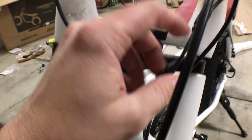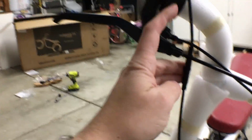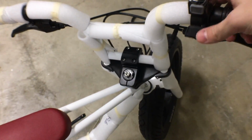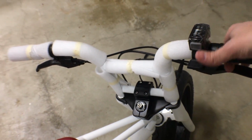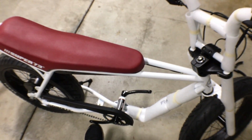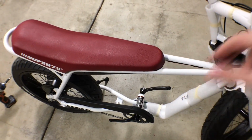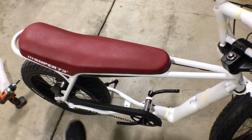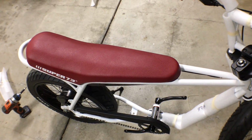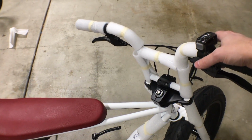And then I noticed it had quite a few pins in there, more than you would need for the brake, so you could get away with just one or two, or one on a ground. But there's also all the signaling that runs back up here to your throttle. So again, one of the things that kept this bike's cost down is that it's just using a little Hall effect type sensor, maybe some potentiometer in there, who knows, and you'll apply torque to the motor with your thumb here, versus other smart e-bikes that would sense the torque that you're applying to the pedals and then use some sort of really simple algorithm, just rules, just ones and zeros, that would say, okay, he's pedaling with this much torque and force, let's give him an adequate amount, let's give him 30% of that to the wheels, and then you would ramp those up. So this is shipped at a cost. One of the things that drives that down is just getting rid of some of the extra smarts and complexity.